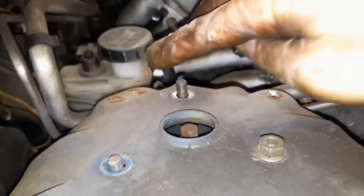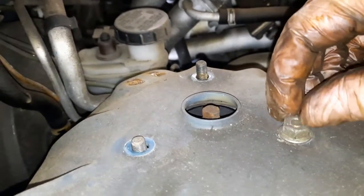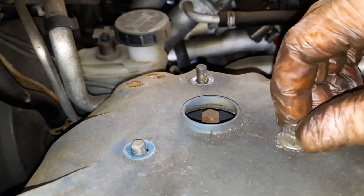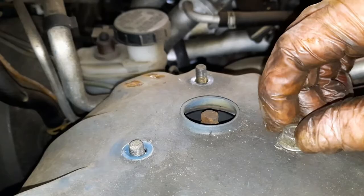So what I've done, I've removed these two nuts, and I've loosened this one off so that it's just on a couple of threads. That way the strut isn't going to fall down to the floor, so I have a lot more control over it. I'll leave that one just on a couple of threads,